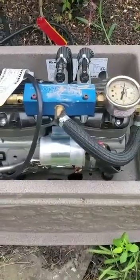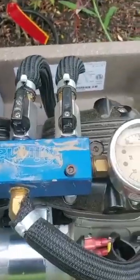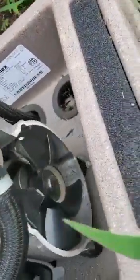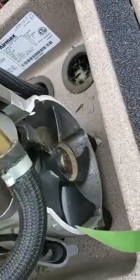So I took the cover off — this is what the inside looks like. I turn it on, the fan's working, you can hear it just humming. So I'm just gonna shut it off quick. You pop this cover off, and if you look, there's an impeller there. If this spins freely, more than likely the motor isn't seized or there's not internal problems.